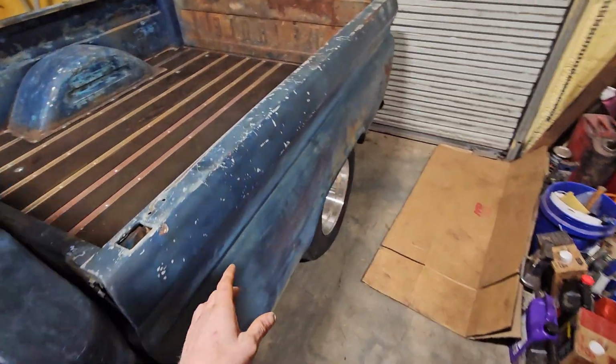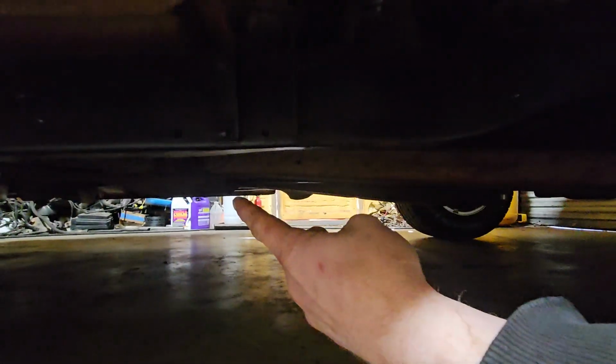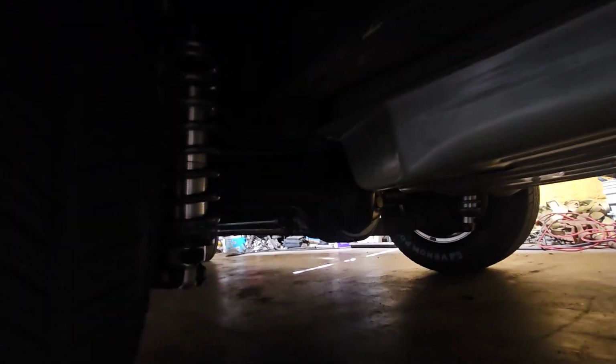On the rear, this has the long trailing arm setup. It's got these long arms that come up to here and then all the way down, and then it has the coil spring went right here, and I had a 4-inch shorter spring. So what I did is I took the shock mount off and then had to pull the bed off and redo the top bracket and moved everything. So now I got coilovers on the rear, and I gotta go back and look how many settings these have, because it seemed like a couple clicks on it was a pretty solid stiff ride as well.